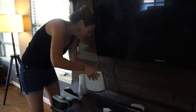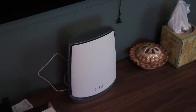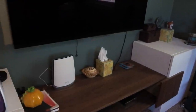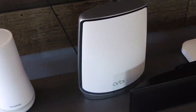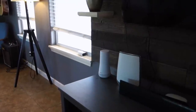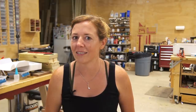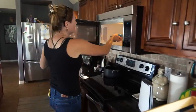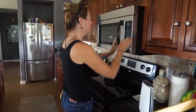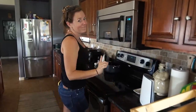Place it up a little bit higher. Also, a central location is important — the closer you are to the router, the stronger the signal. If you place the router at one end of your house, it probably won't reach the other. For whole house coverage, it's usually best to locate it on the main floor near the center, but not in the kitchen. The kitchen is probably one of the worst places — it's full of obstructions, especially metal appliances that damage the signal. Also, when the microwave is running, it can kill the Wi-Fi signal.